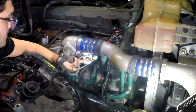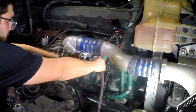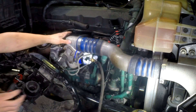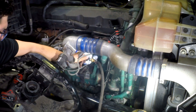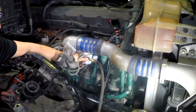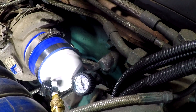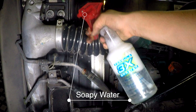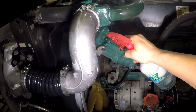Make sure you close the valve before you connect the air hose. Connect the air hose. Slowly open the valve to apply compressed air through the system. Regulate the air pressure to about 10 to 15 psi. Using soapy water, spray down the intercooler, all charge pipes, hoses, clamps, and plugs that are under boost pressure.